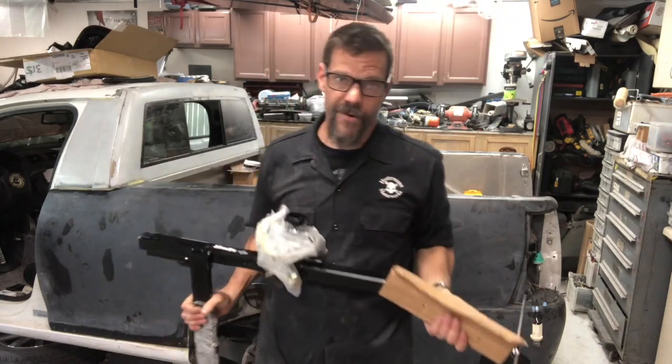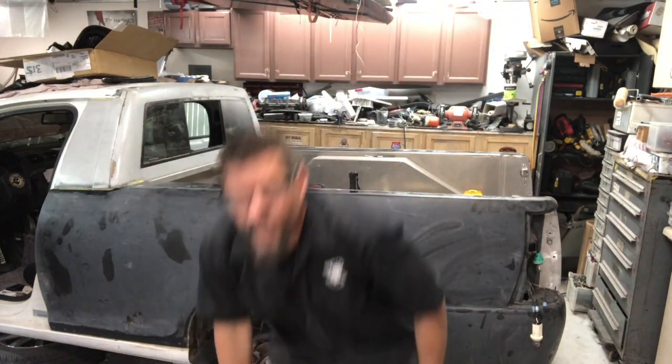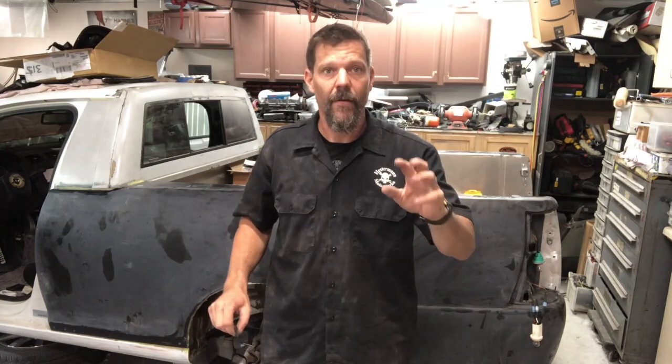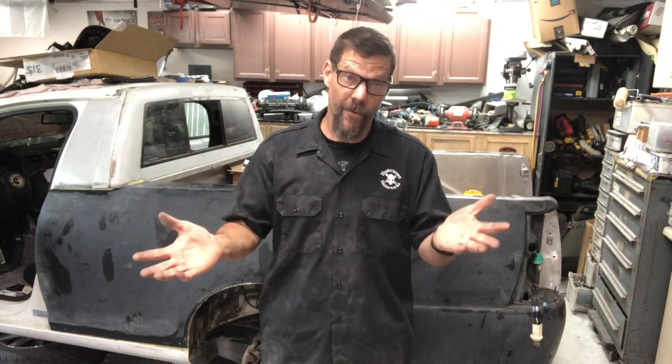When you talk about the Mark IVs, things change. The aftermarket one for Mark IV — I believe it's the same two companies, Draw-Tite and Curt. The Mark IV doesn't all bolt into the frame — one side gets into the frame, the other side bolts into the sheet metal of the spare tire well. They give you a plate that's maybe five by three, but I always fabricate a bigger plate because I don't like bolting into sheet metal for towing. So for Mark IVs I really don't like the aftermarket hitches, and again they're one-and-a-quarter with nothing else available.